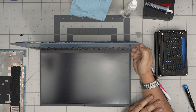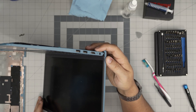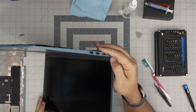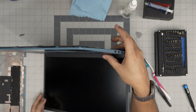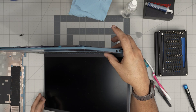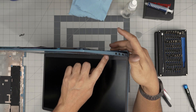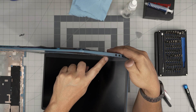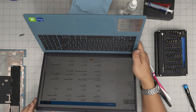If it doesn't turn on, plug in the charger and wait. I got the screen — it turned off again, so I pressed F2. Even if the light turns off, just wait after you press it. Now it didn't shut down. I pressed F2, and there we go — we are in the BIOS, all good.